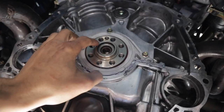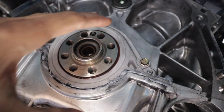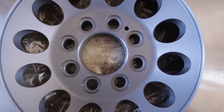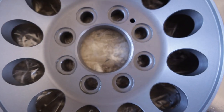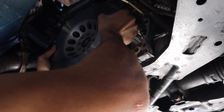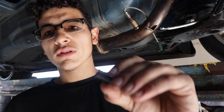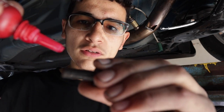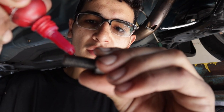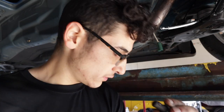The new clutch line is in and it looks phenomenal. Now for the flywheel — you can see this little pinhole on the crankshaft, that's where you put the guide pin on the flywheel. Here are all the bolt holes for the flywheel, and that little pin hole is where your guide pin goes. Guide that pin in. You're going to want some red Loctite thread locker — put a little dab on all the flywheel bolts and then thread them on.